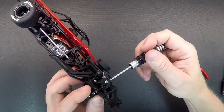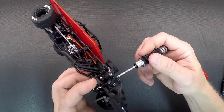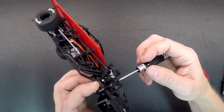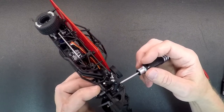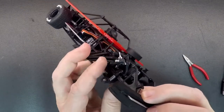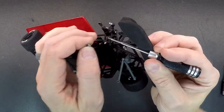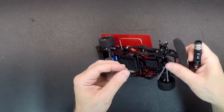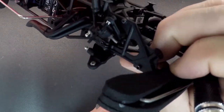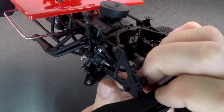Make sure that your spring platform is all the way up. If you do have spring tension and you want to go to a different spring, you can do that, but we recommend backing it off the first few times. Put your finger up above the spring, just pop it out of there with the wrench, and it'll pop right out. Now this lower control arm has a hole in it — there's a pocket or hole in the lower control arm, and that's the spring bucket.